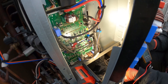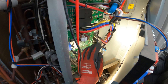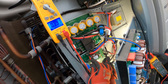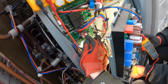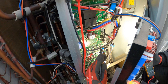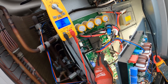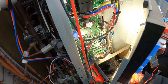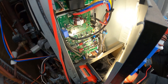The next check will be the IGBT. This board is bad, we already know it, but I'm going to do the next check. Put the black lead on P — it's important which lead goes where when dealing with DC volts. Black on P, then red over here: supposed to read between 0.38 and 0.7. Got 0.39, 0.39, 0.39 — that side checks out. Positive on negative and check again: 0.39, 0.39, 0.39 — the only thing that survived. But the diode went out and the resistance check is no good. Bad inverter board.